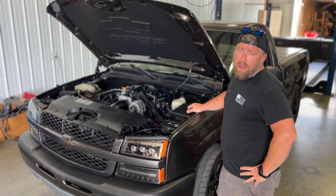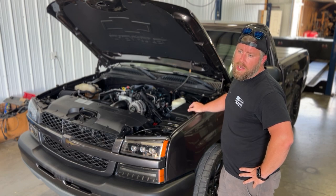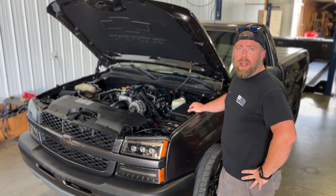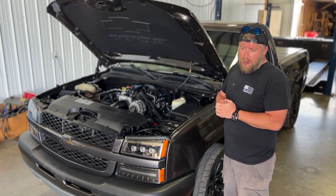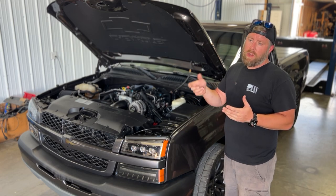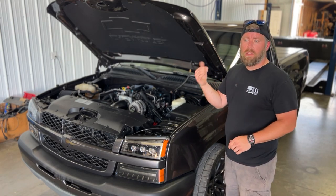Right away, we're not starting off on a good foot. Whenever I went to move the truck from the parking lot inside, that long crank time with that pop is usually a sign of a bad cam sensor. So this truck's probably going to end up throwing a P0342 or P0343 cam sensor code. Basically what happens is you go to crank it, the truck doesn't see the cam sensor. So if you shut the key off, it fails and goes into batch fire mode, and it'll fire right up.